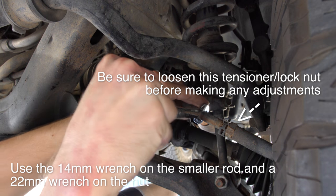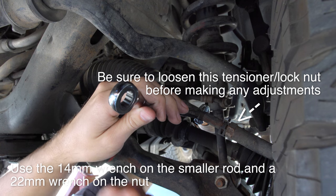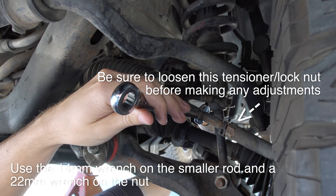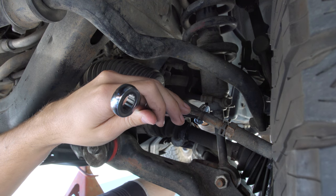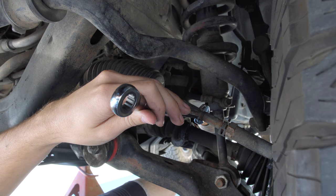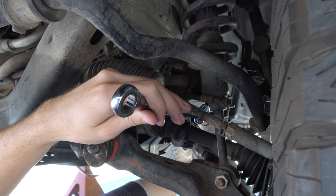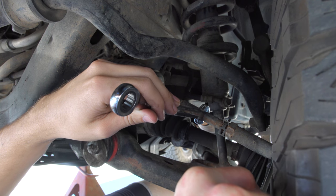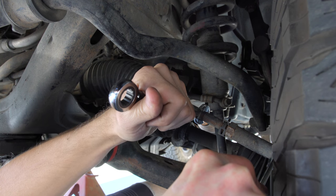Stick this on here and based on my reading I'm going to want to do a 180 turn. I think it's about 15 or 20 degrees per 360. And I think I'm right around maybe seven or eight degrees off on the steering wheel. So we're going to do this the same on both sides — loosen this side, tighten the other side.